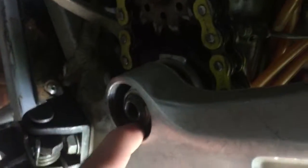Along with these bolts here, the engine mount bolts, I can't get them free either. I sprayed WD-40 on them, everything. They won't break loose. They just spin in there. On the nuts on the other side too. I tried using an impact wrench with a wrench and socket on this side. Nothing. This here, I tried using a breaker bar.